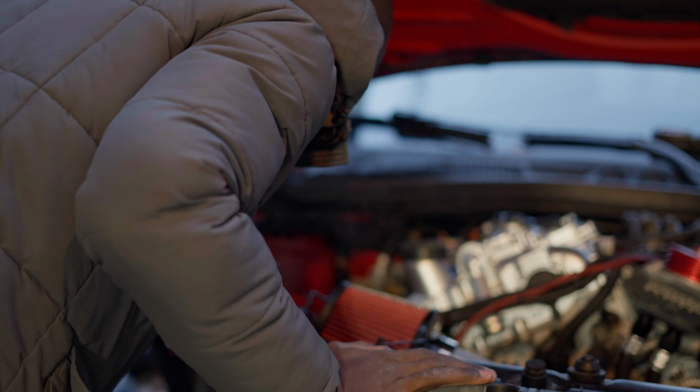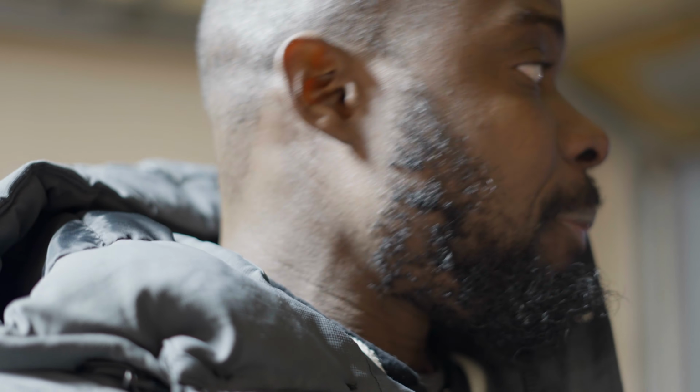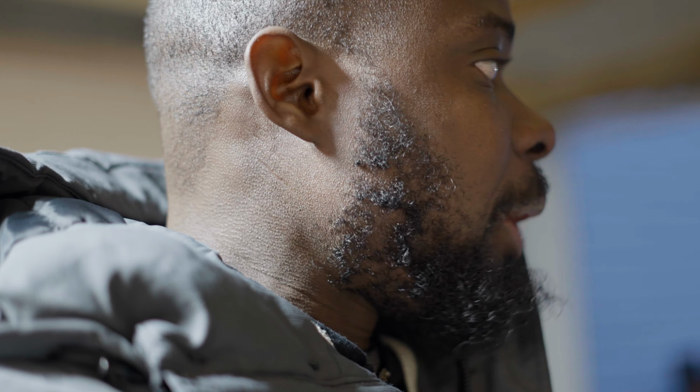This again. This was a very rookie mistake and very stupid. The low pressure fuel pump line was not properly connected. And I wonder why. Before I started this car, I literally put my hand behind and I thought it was snagged in, but it wasn't. So that's what caused the fuel just dumping everywhere.